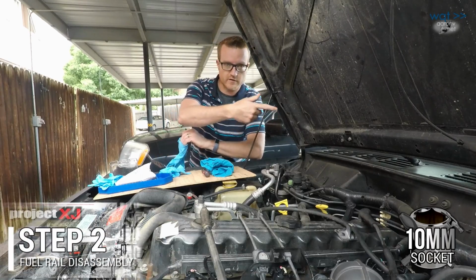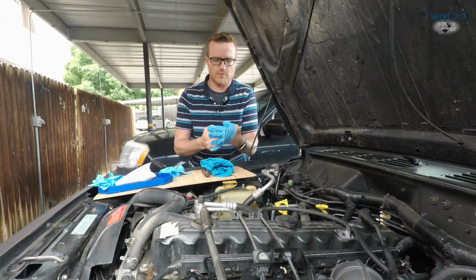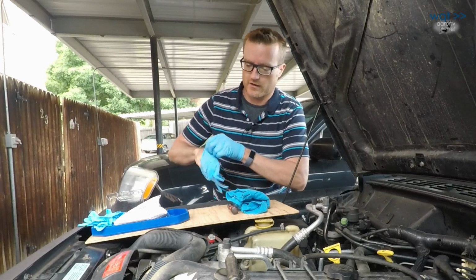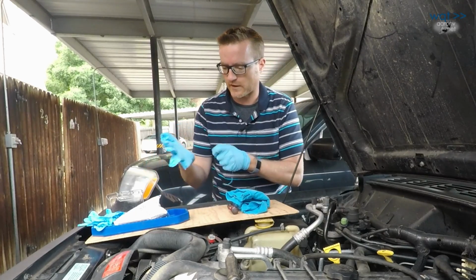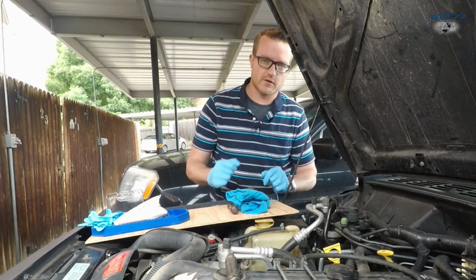The 6 injector plugs that we replaced last night survived a hot run without any issues at all, so I think they're all making good electrical conductivity. Now, let's go ahead and switch the injectors, and hopefully we don't have any problems, but if we do, we can be reasonably confident it is the injector and not one of the electrical connections.